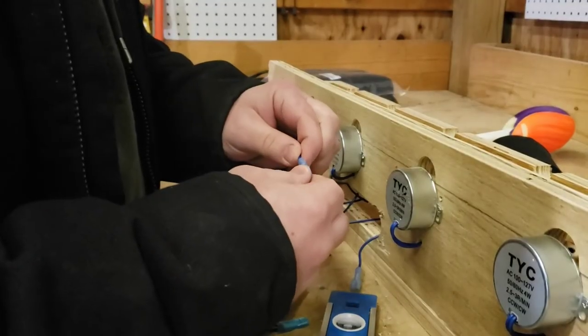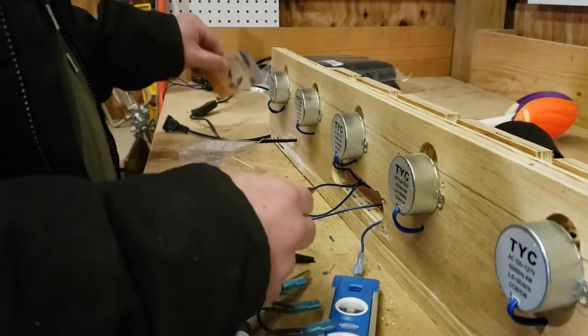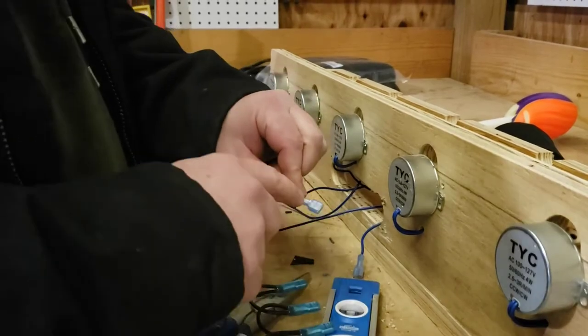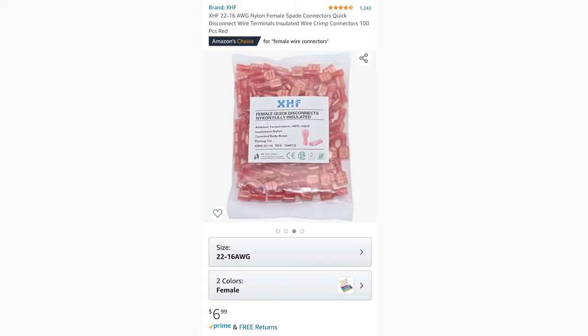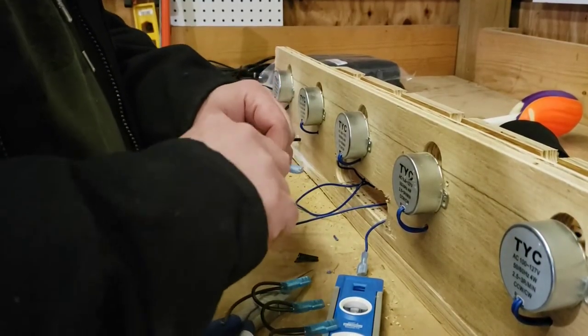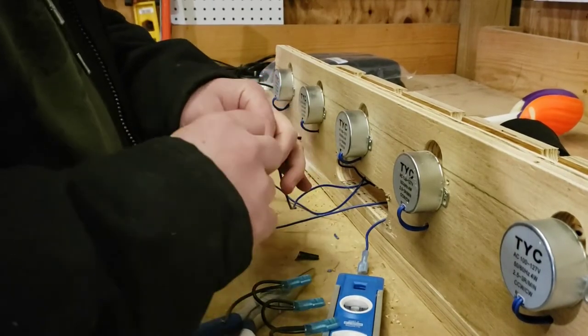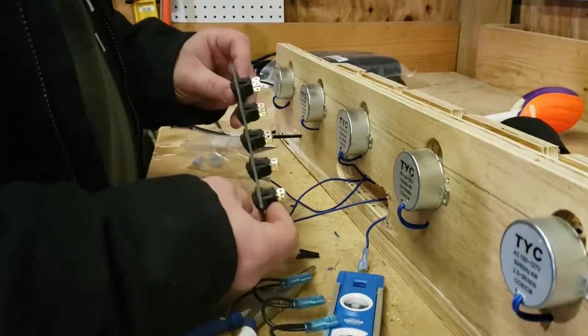So with these connectors, they are a smaller gauge wire than the 14 to 16, but I will link the correct connectors in the description below. All I did to make these work is I cut the wire about twice as long as I needed it, folded it in half, and then put it in there so it had a little more to grab onto. We're going to wire this back up.